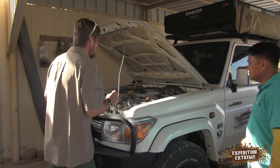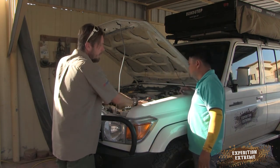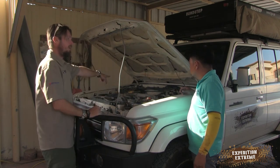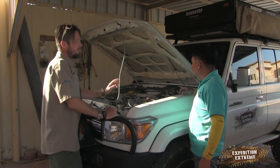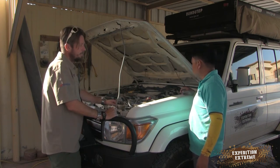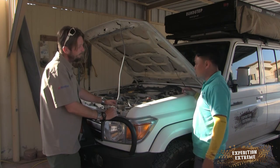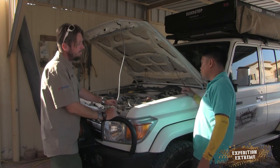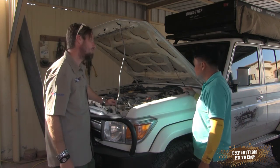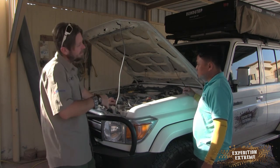Okay, Ray, so what I've got here is my cranking battery. That's working right now. That's not a problem, but both my auxiliary Yellow Top Optima batteries have died. They're currently at about 9 volts. It should be 12 and above. Mostly for a proper battery, it will be 12.65 when properly charged. I think they've eventually died with all the discharge and the charging and the solar panel.